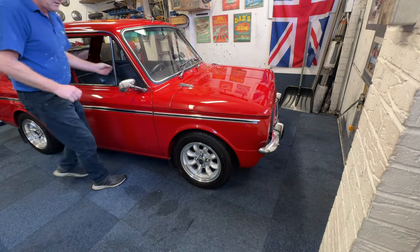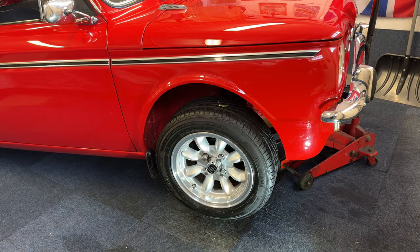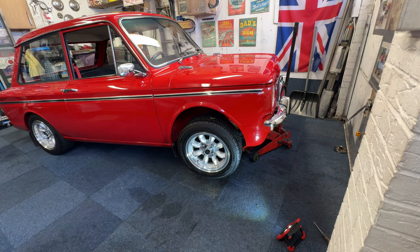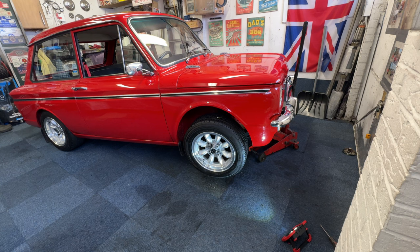Switch my lights off. Next stage is to get the front jacked up, check the king pins, get the wheels off and just check the brakes, readjust them and whatnot. Car's now jacked up. There's a little bit of play in the king pin on the driver's side which will get taken up with the grease, however I've got no grease from the grease gun so I'll have to get some tomorrow — being Good Friday most places are shut. I'll head up to Euro Car Parts or German Swedes and French and get a couple of cartridges for the grease gun.